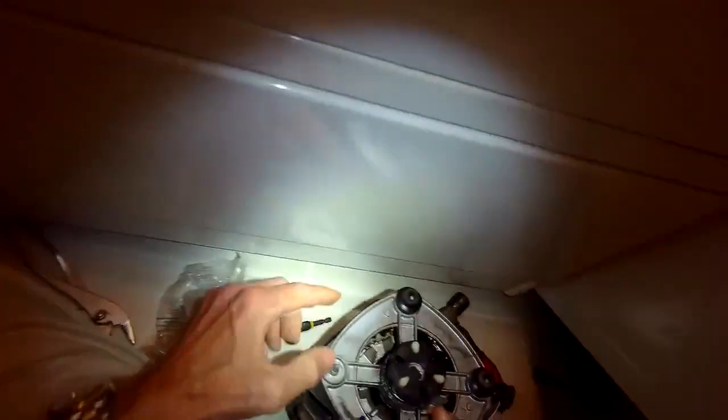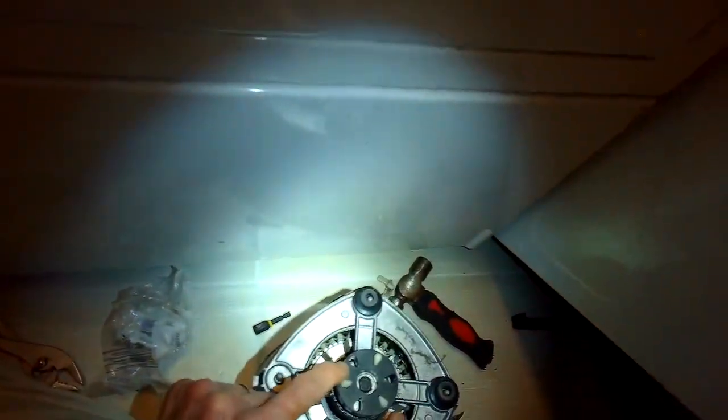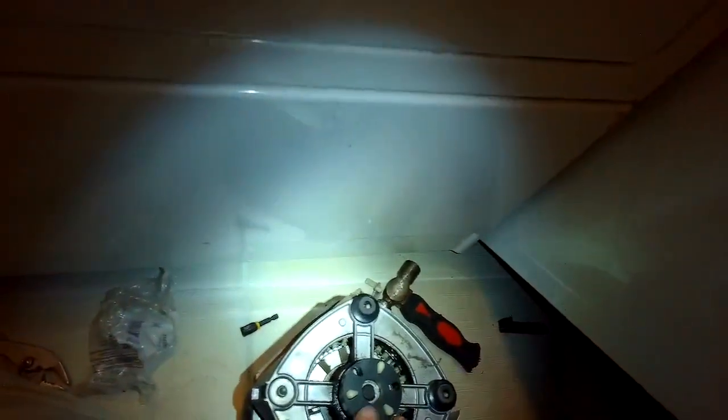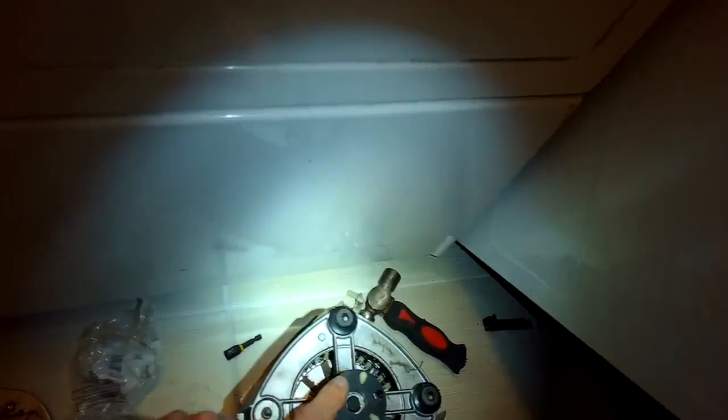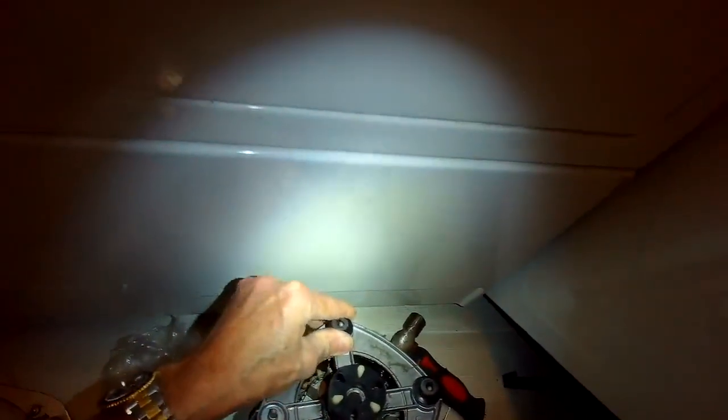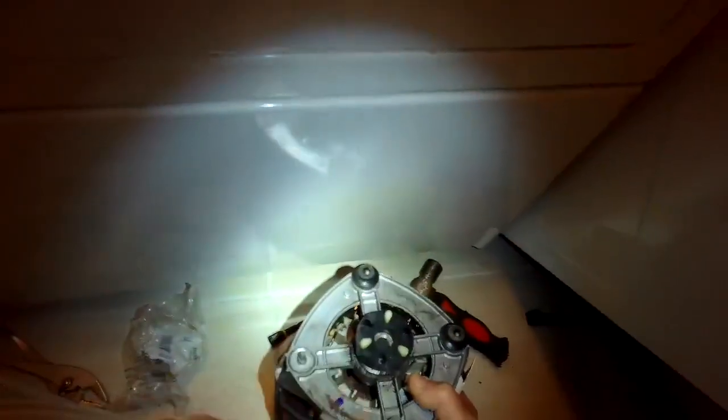And if we look at the motor, this is the top of the motor. Let's put one of the open holes at the 12 o'clock position. And then there's another open hole at 8 o'clock and 4 o'clock. So that helps when we put this thing back on. Also, there's 4 little rubber feet. 2 of them are still stuck on the motor mount. I'd like to put those on the motor first, and then I'll put the motor back on. This is kind of the tricky part because you have to line up the forks that are on the transmission into these holes. A little tricky.